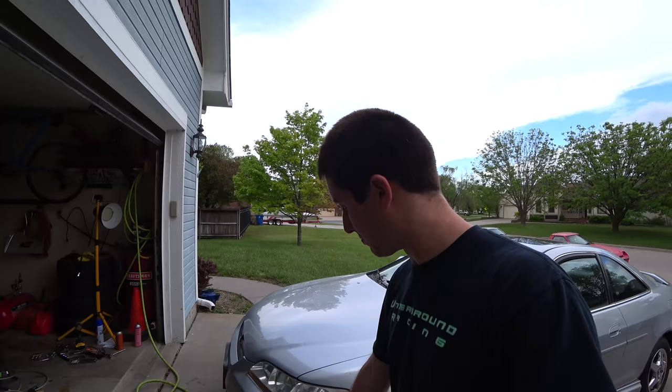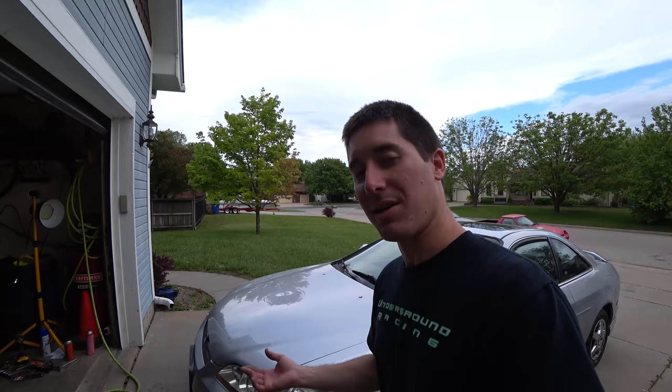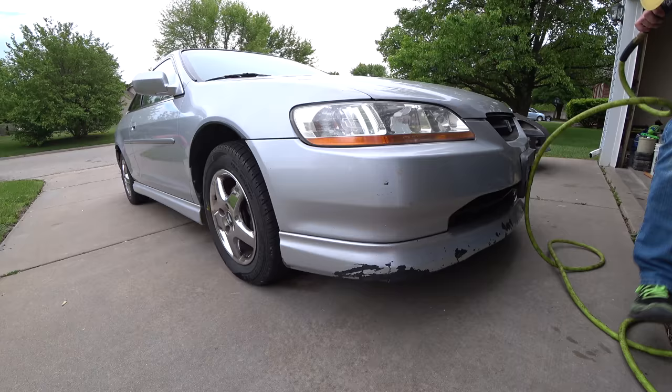So let's get this sanded, do a little bit of prep. We'll just wipe it down with alcohol because most of it's plastic where we're working, at least the bumpers are. Then we'll mask with newspapers quickly and throw some paint on this. Hopefully it doesn't take too long. I also bought some clear but I talked to a painter friend of mine because I have zero experience painting cars. Honestly, I consider it to be an art and only body guys should do it, but you can make something happen yourself I assume. Let's get to work and hopefully it looks good at the end of the day.